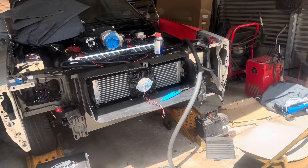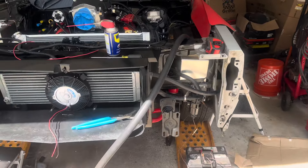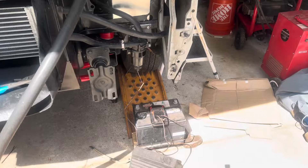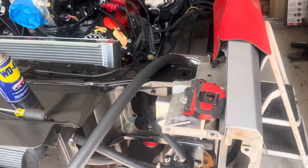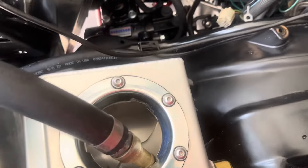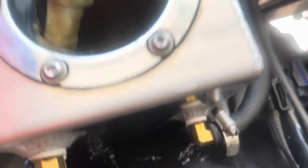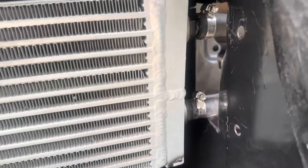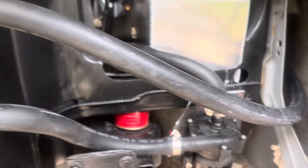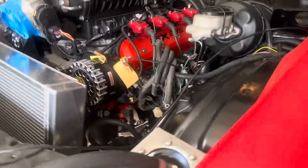Okay, new day — I'm back out here. I just finished piping in my supercharger, and I got my lithium battery right there to put some power to the pump. I got my water hose going into the tank. I'm gonna fill it up with water and see if there are any leaks. Once I fill it with water, I'm gonna let the pump circulate and see if I can find any leaks — between those two lines, right at the pump itself, and back right there at the intercooler. I definitely want to see if there's a leak in the intercooler before I start putting the good stuff in.